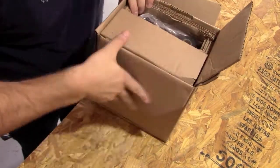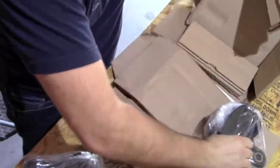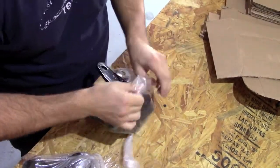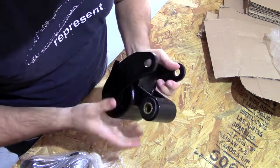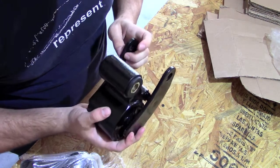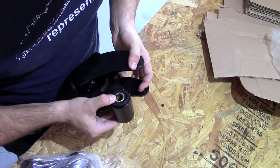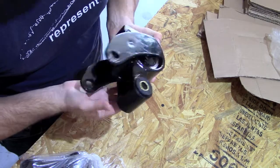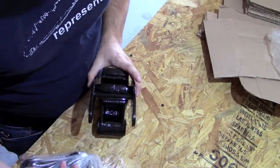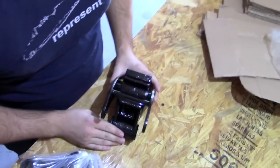So you get the shackles themselves, a bunch of washers - these are for spacers, I'll show what that does in a little bit - and then the other shackle. First impressions: I'm impressed at how big it is, I thought it was going to be a little bit smaller. I like how they use nice thick steel - it looks like about quarter inch thick or maybe five sixteenths. Nice big robust bushings with a nice pressed-in sleeve, looks like brass but it's actually grade eight steel, hence the grade eight washers as well.